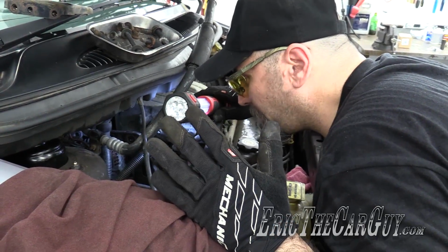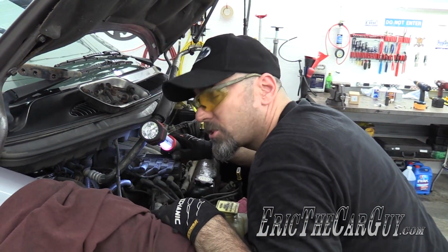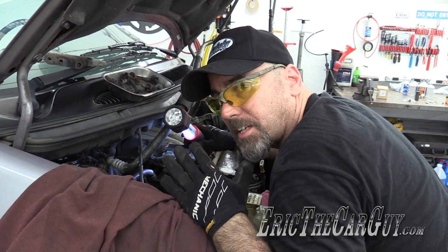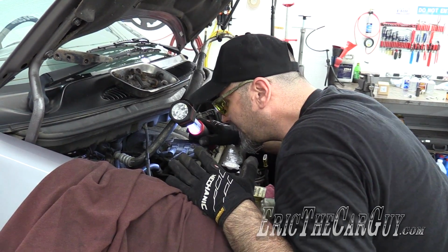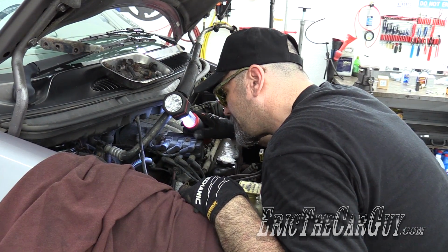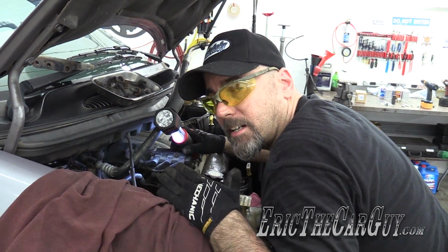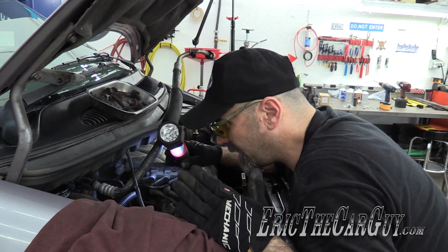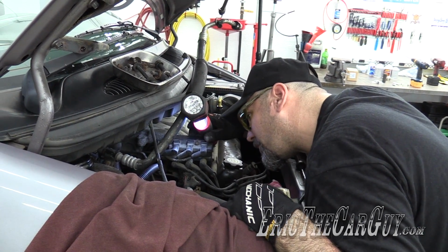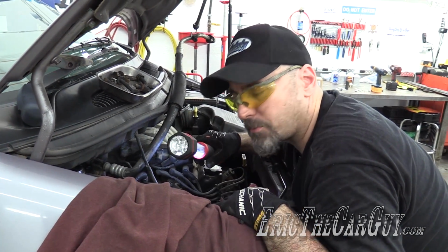You couldn't have just put a regular Schrader valve in? I mean, seriously, all you had to do was put a Schrader valve in it. Instead, you have to make this Rube Goldberg setup that is just completely unserviceable. Because if you try to twist that fitting out of that line, you're going to break the line. And if you break the line, you've got to replace half the AC system, it looks like. Well done. You made your vans disposable.